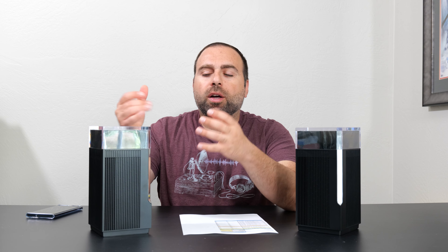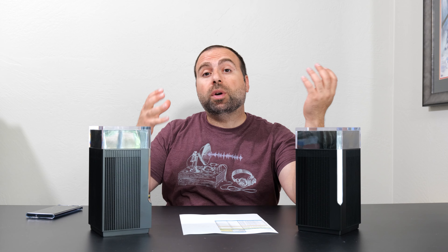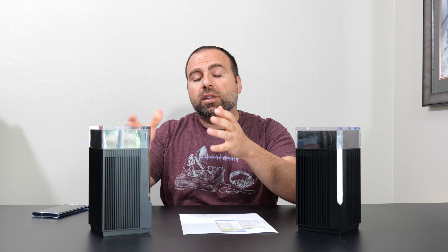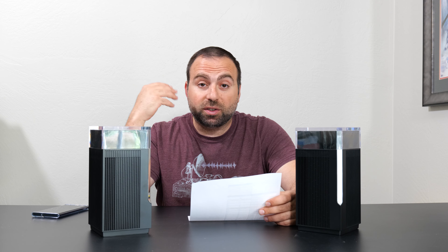To find the true peak performance, I remove my ISP and the public speed test server from the equation by making my computer a local area speed test server. Essentially I go from phone to router to computer, isolating the router. In the single router configuration this gets me amazing numbers, especially with the Wi-Fi 6E device — the fact that a Wi-Fi device can go faster than gigabit is crazy.